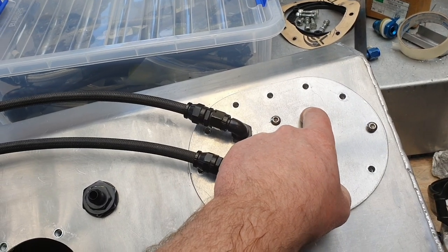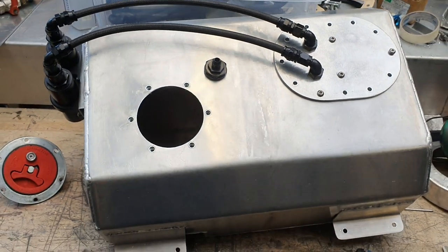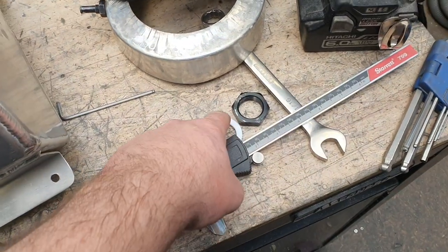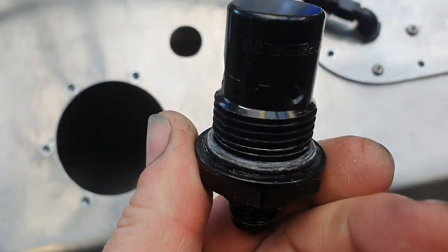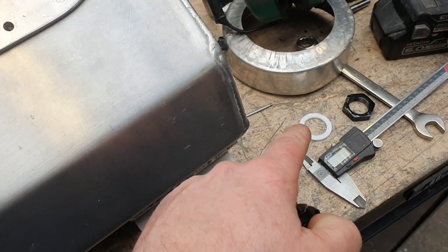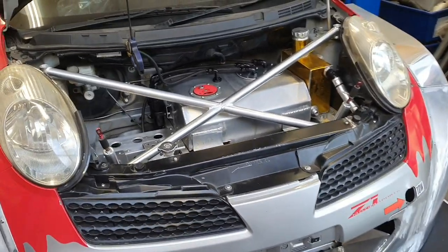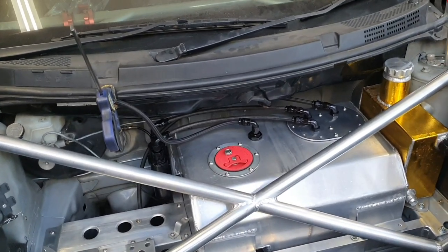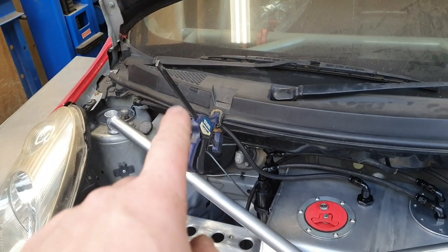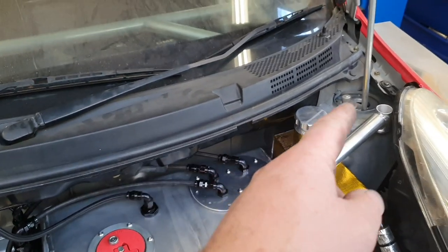There's also a bit of feng shui going on — if we put a 90-degree fitting on there and head the hose this way, everything lines up beautifully. The fuel return hose fitting will go about there, so at that point we'll have four hoses all nicely spaced out. It'll probably look absolutely crap, but I'm trying to make it look nice. The O-ring sealing is sorted — this time I've made the hole big enough so it just crushes on the outside of the O-ring and the washer squashes up against the bottom to seal it absolutely beautifully.